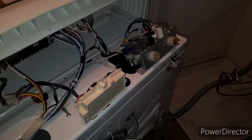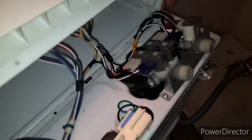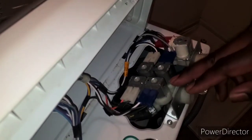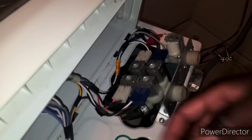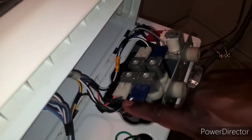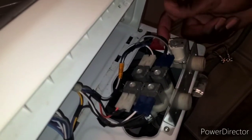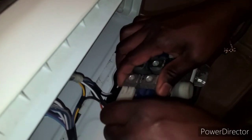I got those two screws out — put those to the side so you know which ones they go to. Now the way this is set up, you've got two blues and two whites — yours may be different colors, but on this particular model that's what you have. Please use your camera and take a picture of this so you know which side these go on. You'd think the connectors are duplicates but they're not — one blue has two black wires and a white wire, the other has a gray wire and two black wires. Make sure you know which one goes where.